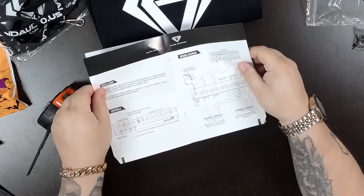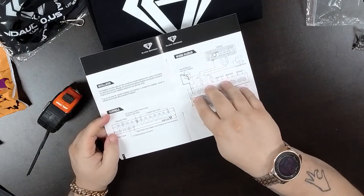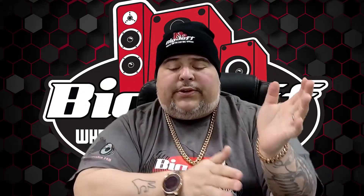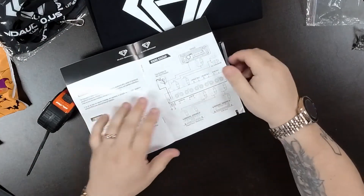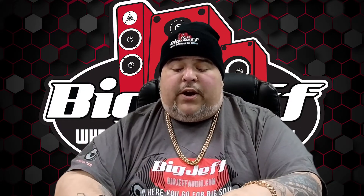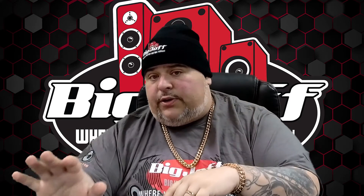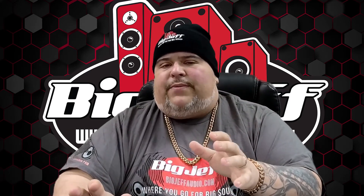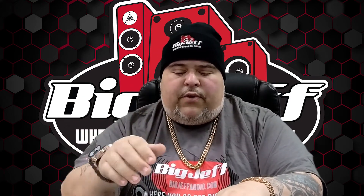Let's look at some more information in here. We've already discussed how to hook it up — you need a ground wire, a 12-volt wire, and the remote wire, which tells this thing to turn on and off. You have your auxiliary input and your main input. From your amplifiers you can run up to three amps, or you could do a four-channel and a subwoofer. And if you only have two amps, that's fine — you can hook up your subwoofer output and either your front or rear.